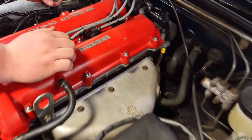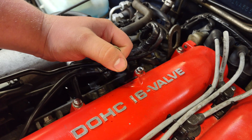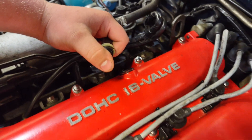Now we jumped on Marco's green Miata and got his PCV out. We're doing the click test — put your thumb over it while the car's running and you can hear it click. That shows it's functioning.